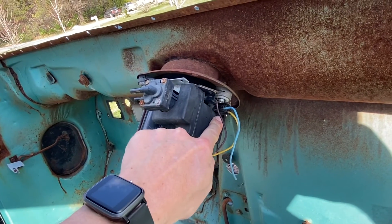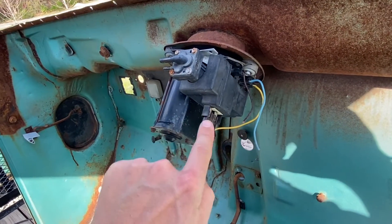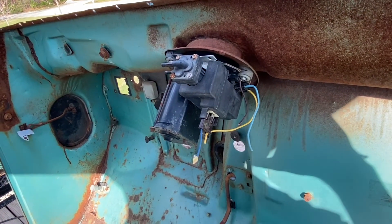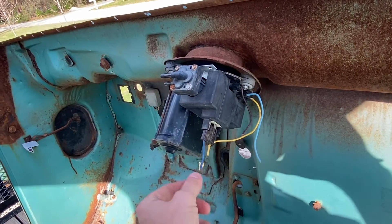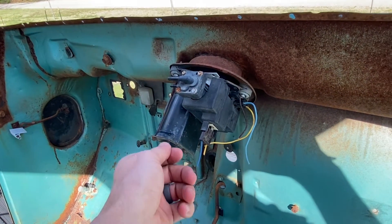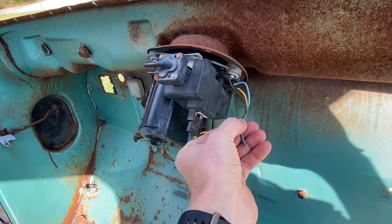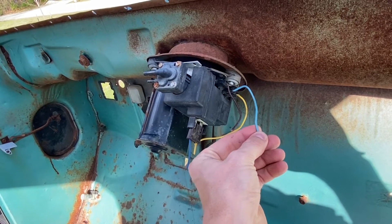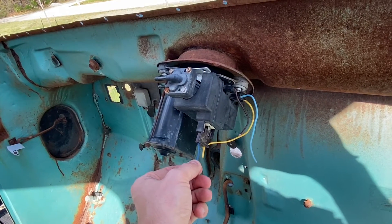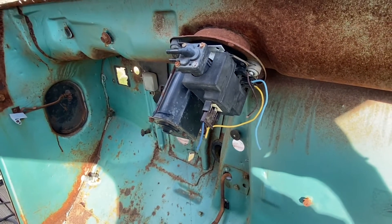We have a single and a double black plug that both go to the motor, and then a double brown plug that goes to the pump itself. When we turn the key on, the yellow wire is going to give us constant power from the fuse box and all the rest are going to be grounds. The black, light blue, and dark blue are all connected to the wiper switch at the dash. When we turn it on to low speed, we're grounding out the black and the light blue wires. For high speed, we're just grounding the light blue. To actuate the pump, we're grounding out the dark blue wire. If we don't have these wires in the correct position — blues on the top and yellows on the bottom — you're going to run into all sorts of problems.